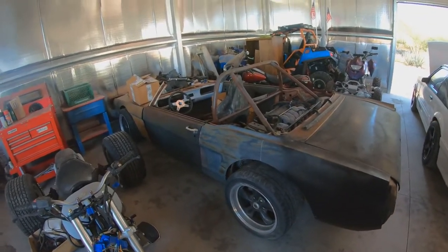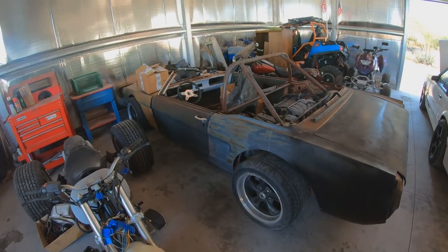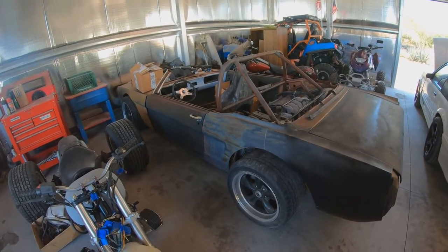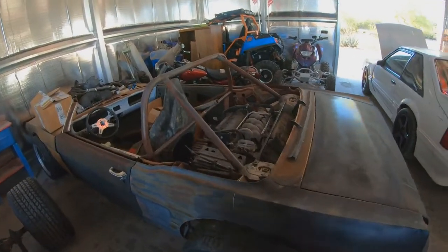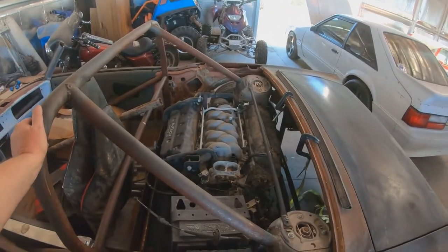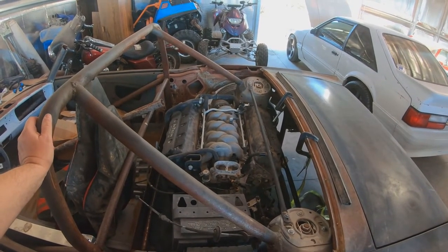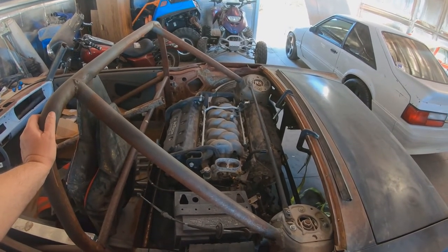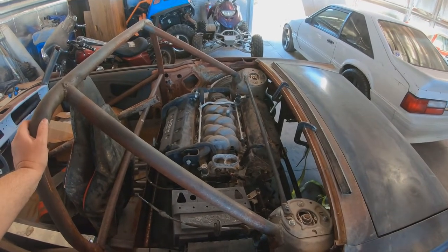So the front suspension was changed out, and in the rear, I cut the whole floor out and everything there, and this is out of a 2000 Lincoln Continental. Now, I didn't normally plan to put a Lincoln engine in it, until I found out that it would fit in here. It has a 4-cam 4.6 mod motor, and apparently these blocks can take up to 1,000 horsepower with no issues. So I will put forged internals in it when I go to rebuild it.